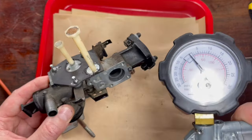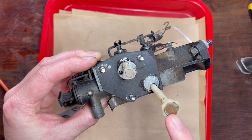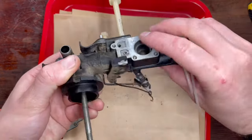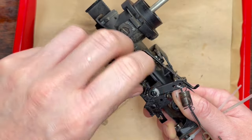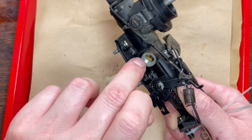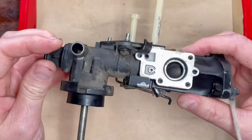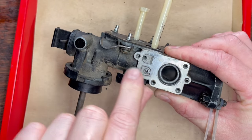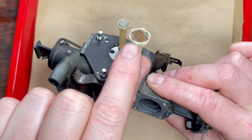It's a really quick test and it will tell you straight away whether you've got any leaking. You don't need any specialised tools like a pressure and vacuum tester. And we can now move on to the next stage which is actually going to be cleaning these two little fine mesh filters. We're going to clean these filters out and we're also going to clean out the drillings that are in this carburetor. Just a quick heads up while I'm taking this apart again — this needle will not seal that little drilling in there fully. So when you're blowing through the smaller tube expect to lose a little bit of air there. So the holes that we need to clean — and we're going to use some brake cleaner in this case — we've got one here, one here. This hole should squirt out from under here. This hole is going to squirt out that tube and it's going to clean all that dirt that it's picked up.